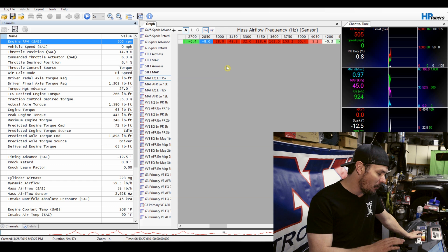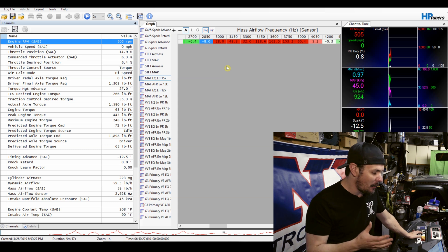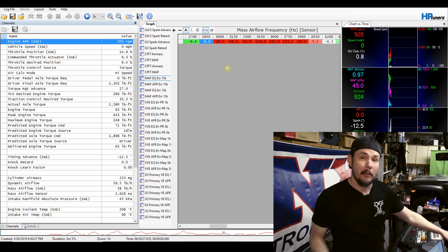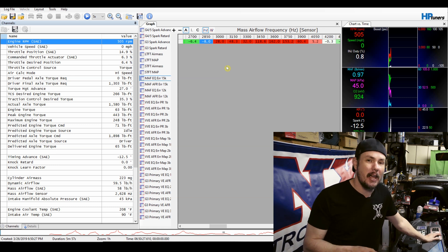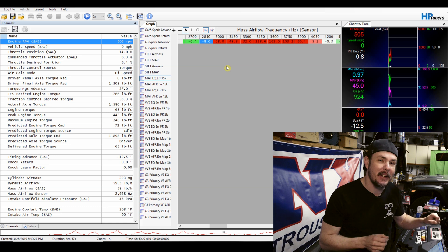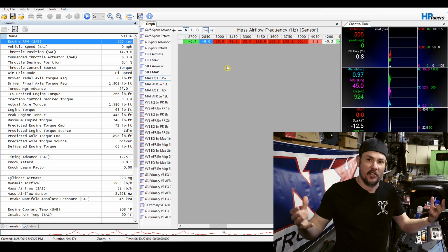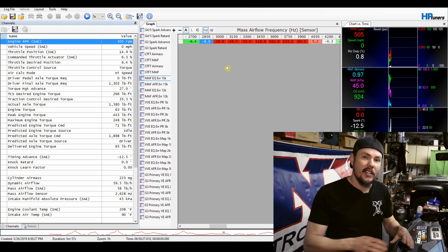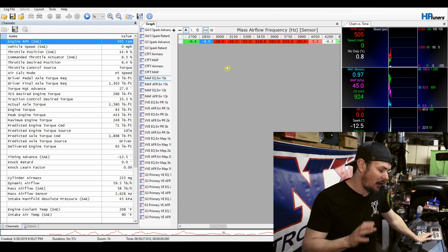You would not be able to get this thing dialed in at idle on the mass airflow sensor — you would be chasing your tail forever, because it's going to be different every time. This is not something we can get consistent data from and level out. That is because of placement, camshaft, and just the dynamics of the way the engine breathes down low. The speed density table — volumetric efficiency — responds a lot better to this kind of situation. There is some filtering there that says, okay, this is what our manifold air pressure is reading, and it extrapolates that out in the air-fuel calculation, giving it some time, so it kind of averages itself out and runs a lot smoother.